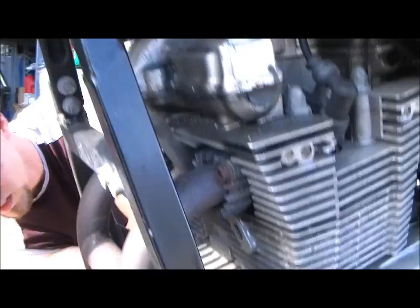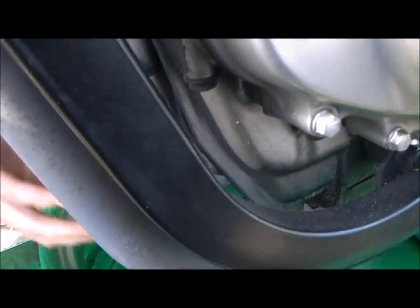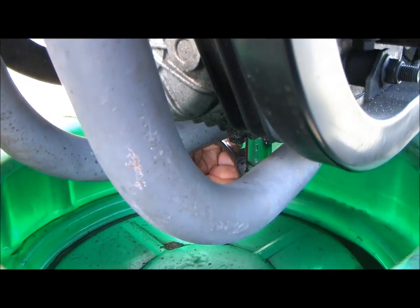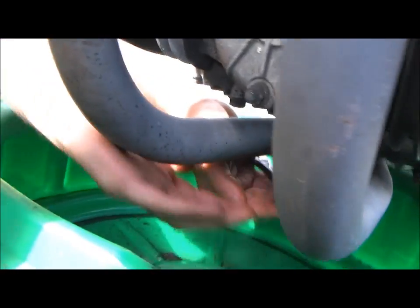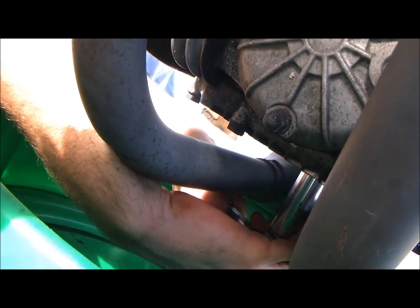You need some new rubbers in your valve cover bolts up here. I don't think it's your gasket — I think it's the rubbers that are supposed to be under them bolts. Just under the bolts? Yeah, there's little rubbers that go under there. That's going to be easier to replace. I'll put on new bolts at the same time.